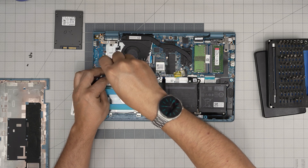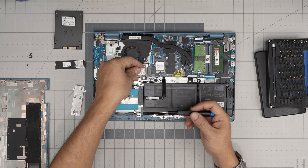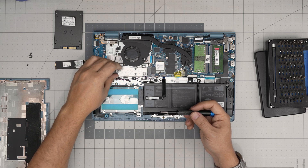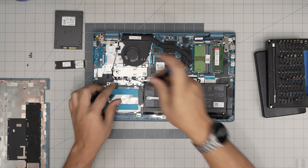To reinstall the M.2: remove the one screw on top, pull it back, put the new drive in at 45 degrees, bring the bracket in, push it down, slide it in making sure the screw holes align, and put the screw in.